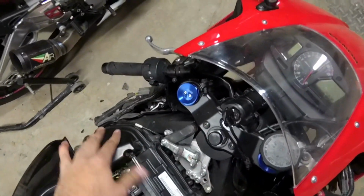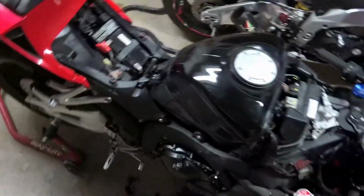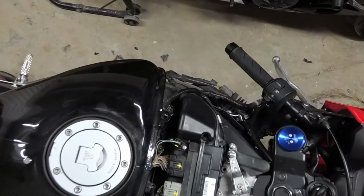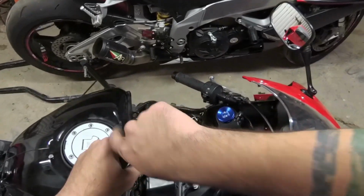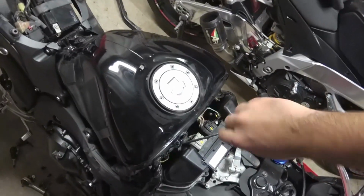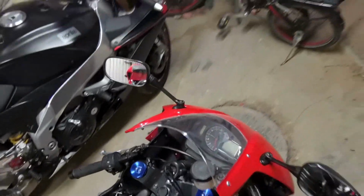This is in. Let's go ahead and put back these 6 screws. There you go. I try to do a crisscross pattern, so I'm not tightening them down all the way, just until the point where they kind of stop a little bit, and then I tighten them down in a crisscross pattern. And now I just need to replace everything back, and basically done.